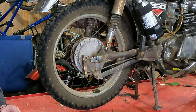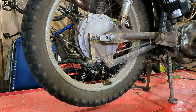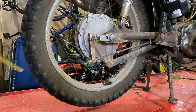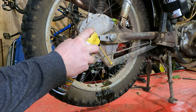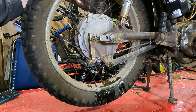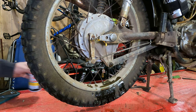Anyways, let's get right to how we take the rear wheel off. There's a lot of crud on this thing, so we're going to use some blaster spray. I'm not saying you're going to have to do this, but this thing's got a lot of rust and dirt on top of the rust. So we're going to spray down all our fasteners before we jump into this.